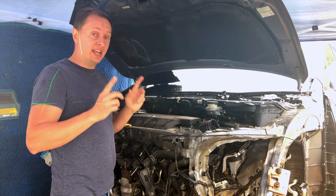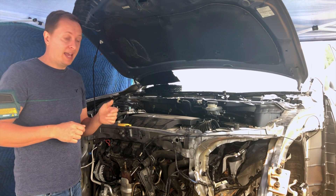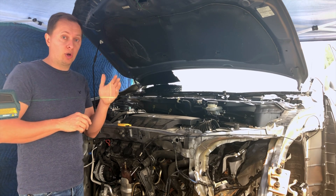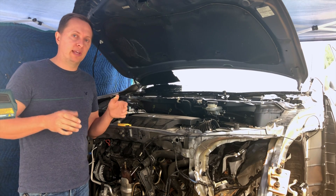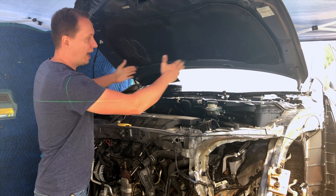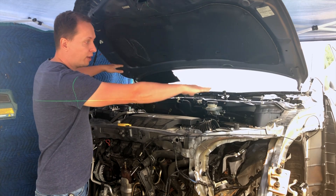This is the next day. It's daylight and raining, so I have this tent up above and a blanket behind me to shield light so you can see the laser beam better. I'm using a green laser now because a green laser is more intense and easier to see during the day. Every laser level will have two lines — vertical and horizontal. We're going to use the vertical line to split the car in the center and measure out from that line to figure out whether anything moved side to side. The horizontal line will be used to figure out if anything moved up or down.